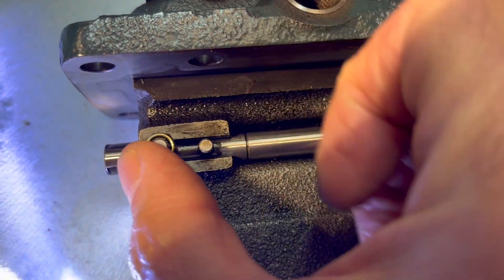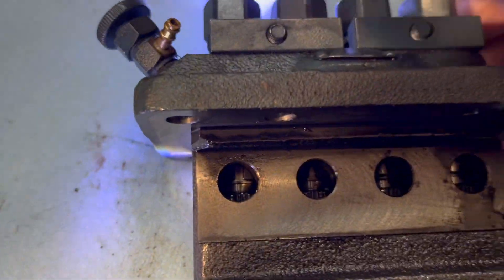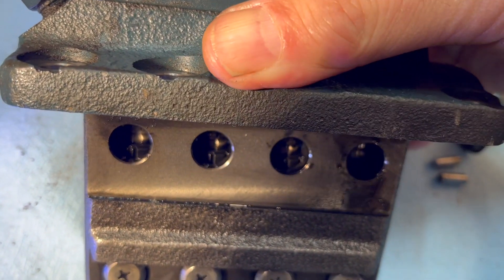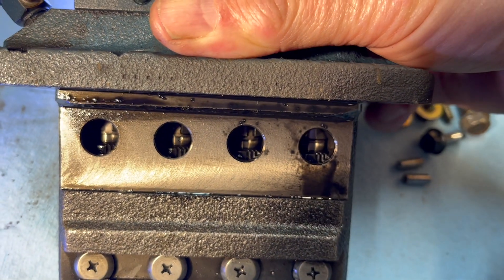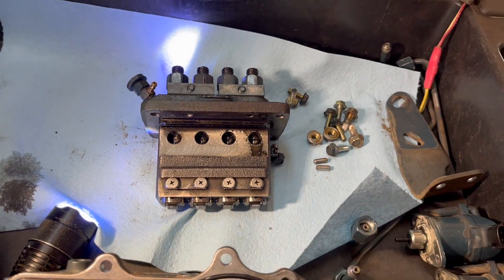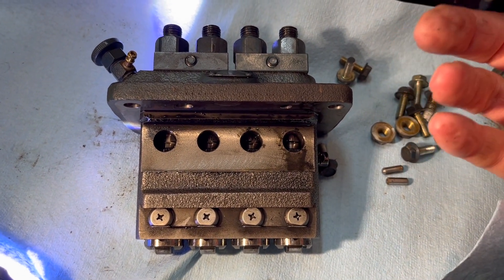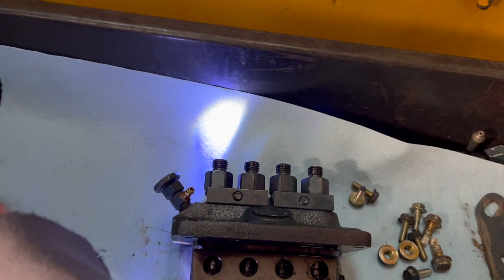This is the on and off valve right here. Flip it over — you can see what that does. There's a lot of resistance in there, a grainy feeling, it's not smooth. There are seals in here, all sorts of stuff. You take these all apart; there are other videos showing how to do that. But clearly what was happening is when we shut it down, fuel was still getting through and just dumping into the system. That's where all that smoke was coming from.